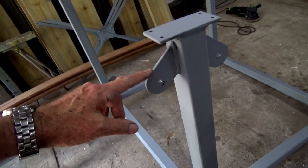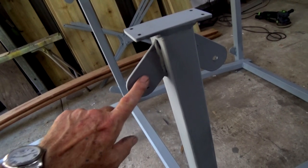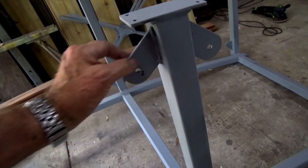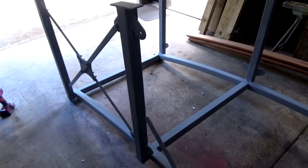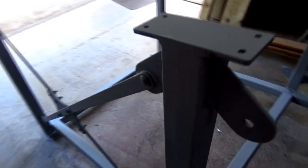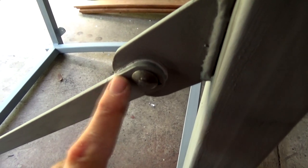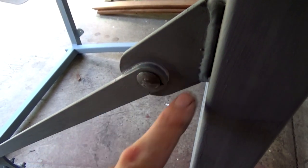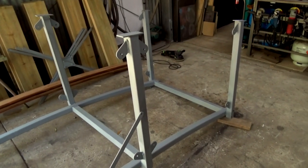Remember, this is hot rolled steel — it's not galvanized. When I put these braces back, I'm putting the polyurethane sealer in this area here and then bolting up that surface tight, so I can stop water from penetrating into that area. It's going okay but it's a bit messy — you end up getting sealant all over your hands as you clean off the excess. The problem is that the top coat I'm using doesn't bond very well with polyurethane sealer, so I'm going to go over that with a water-based undercoat and then put the top coat on. I'm saving the top coat for the big reveal — because you wouldn't believe what colour I've chosen.